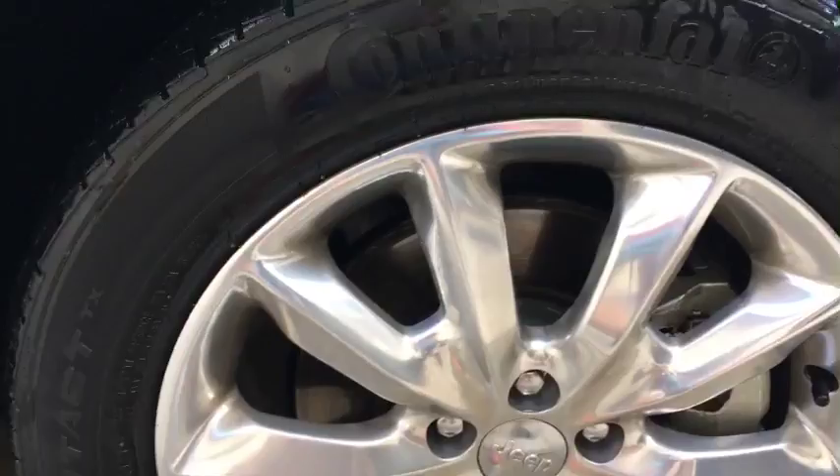A viewer asks: will the degreaser damage the wheel? No. People get real freaked out about using Purple Power full strength like I do on tires because they're afraid it's going to damage the wheel or leave some sort of streaking on the metal or on the chrome. But number one, the little bit of overspray that does get on the wheel is so minimal that it's not a big deal. And number two, this is a factory coated wheel, so it's got a clear coat — a protective barrier. Just like if some of the Purple Power oversprayed onto the paint, you just wash it off immediately and you don't have anything to worry about. I wouldn't let it sit on the wheel for a long period of time, but let common sense lead and it's no big deal whatsoever.